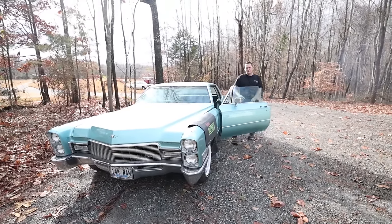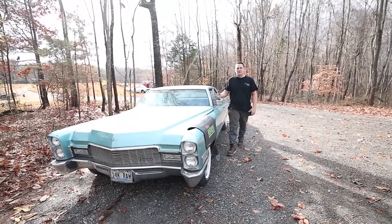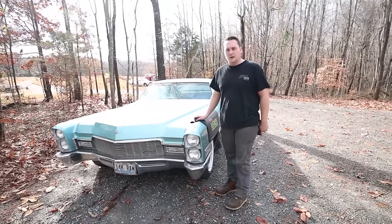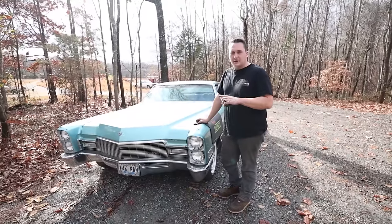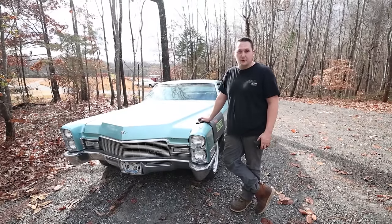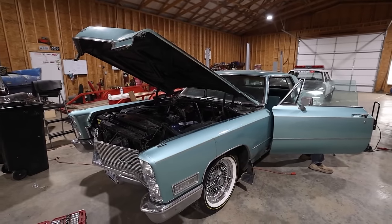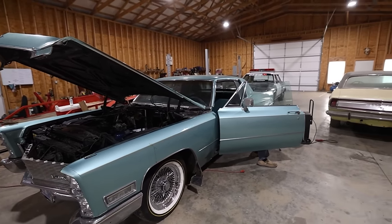Brake booster leaks pretty severely. You can hear it hissing inside the car, so it didn't do that before. When we hooked it up, it's like, yeah, I'm gonna leak pretty bad. So we'll probably have to take the booster off, replace it. But hey, at least it stopped itself, and at least it's running on its own fuel supply at this point. So you know what? That's a major win for us in the right direction. So we've got a huge vacuum leak, and the brakes do not work good at all. I mean, you gotta max out the pedal.